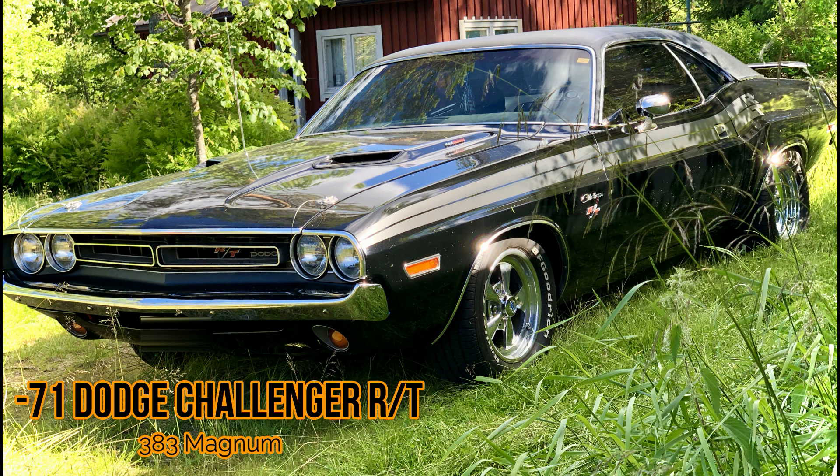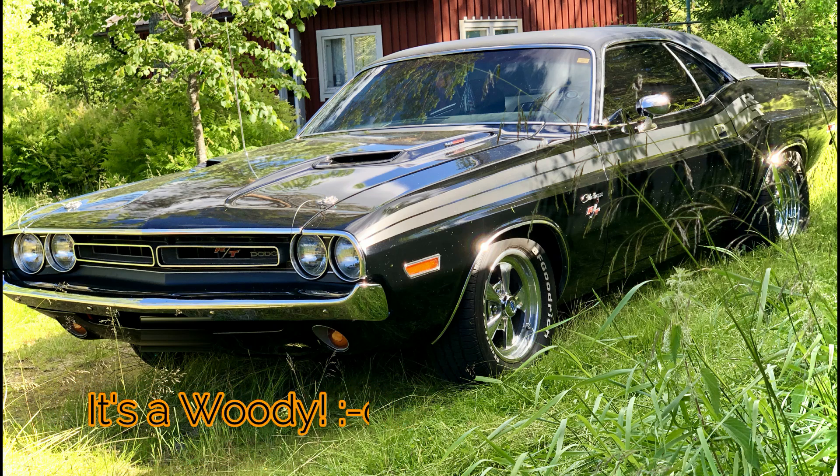Last summer I decided to do something about my Dodge Challenger. I had a lot of problems when cruising with it. It's a massive car so it probably isn't built for slow speed, but the thing is that the fuel in the carburetor would boil and the idle would get grumpy, and if it stops it's hard to restart. Anyhow, a wooden spacer between the carb and the intake can be the solution. Look here how I made the spacer and a little review of how it turned out.